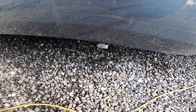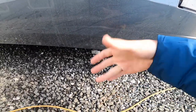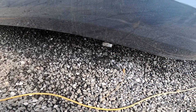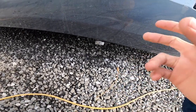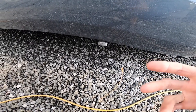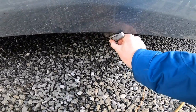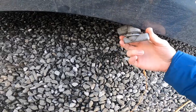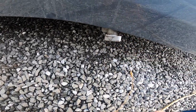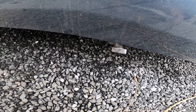Located just behind the skirt on the driver's side beside the driver's door is your waste water - anything you've drained down a plug hole goes to your waste water tank. Simply open it before you leave site because you don't want to be driving around with the extra added weight of dirty water. Open the valve and drain off your waste water from here as it is just a tap. This is one of the points you want fully drained off in the winter as you wouldn't want the water to freeze.